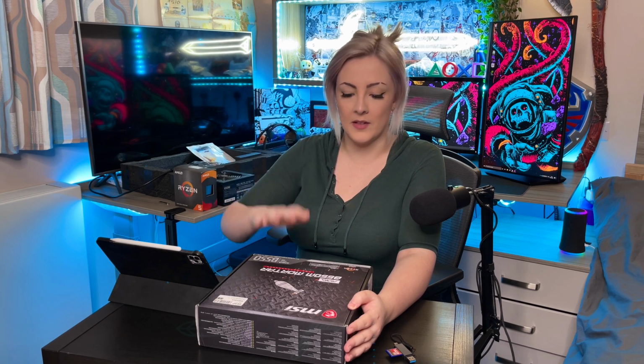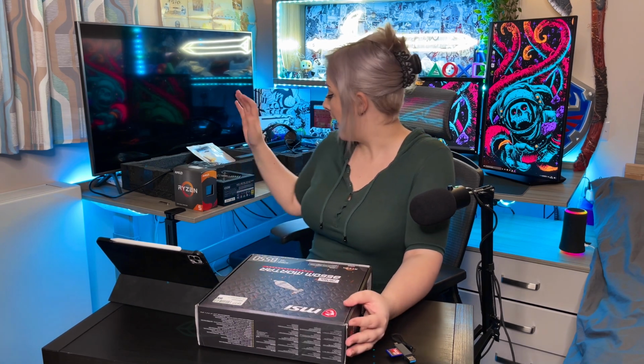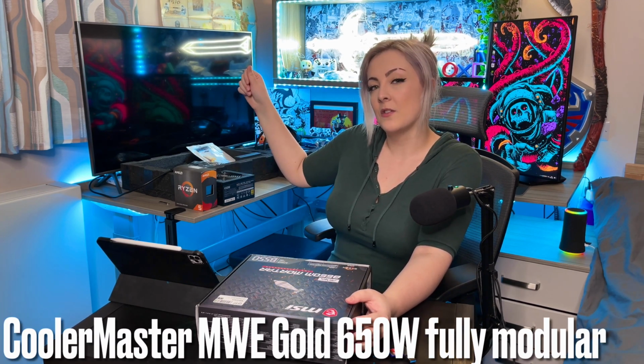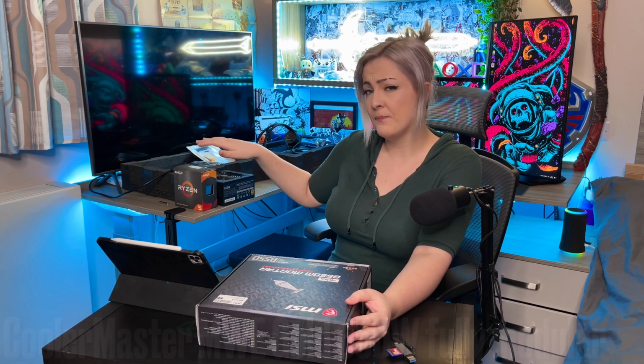So that's what I've decided to do. Because I am on carpet, I've got to be quite careful with the static that I build up, because that can damage the components. So I have got my power supply unit here, which I'm going to plug in and then switch it off to 0, so it grounds but it's not on. And by grounding I mean it dissipates the static charge that I'm building up by walking around on the carpet.